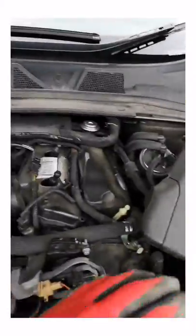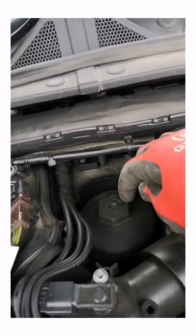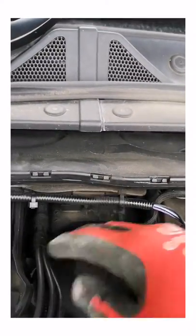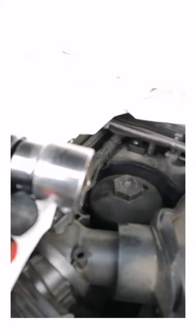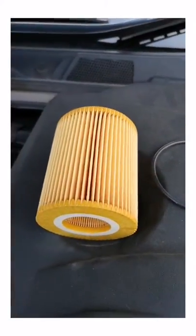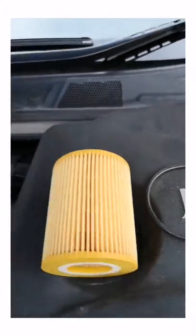That unclips and then you expose the V6 as well as the filling capsule and the oil filter in there. Just be aware there's a plastic top on there, so be careful when you unwind it — it gives you the arrow to indicate which way it comes off to put the oil filter in. The oil is black and really dark. So while it's draining down at the bottom of the sump, we need a 32mm socket for the top of the oil filter casing. Take that off, get a bit of rag ready. What you have here is the new oil filter and the new o-ring — I'm going to rub that round with the old oil just to help get a nice seal before putting it back in.